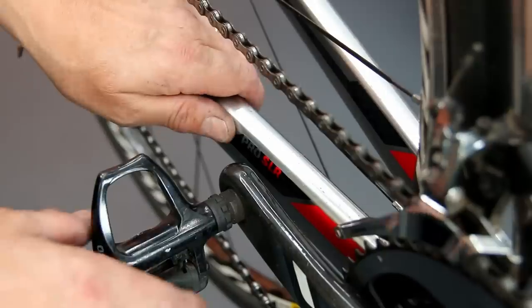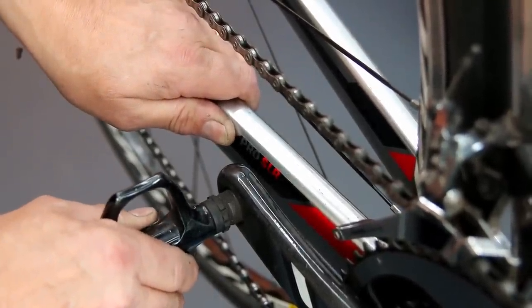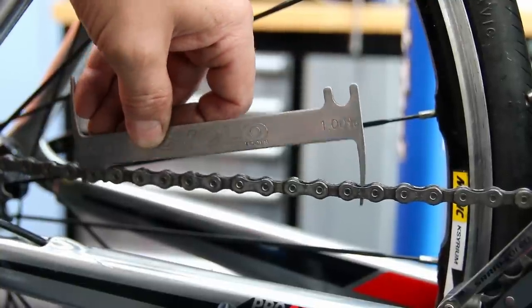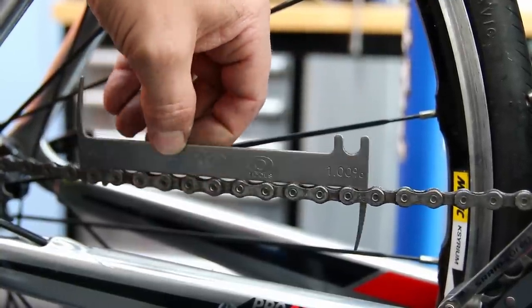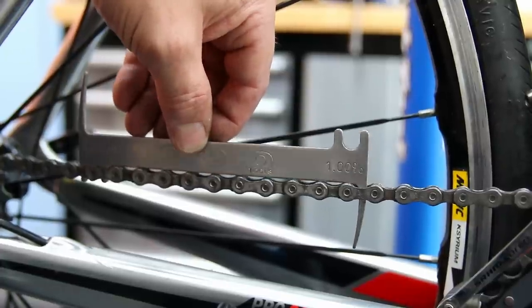During the assessment on the bike, we've got a bit of play in the bottom bracket — a little bit of travel in the bearing — so I need to address that when I service the bike. You can also see the chain is more than worn out, so I need to address that by changing the chain and cassette.